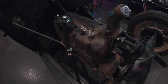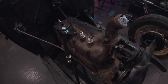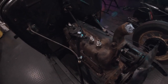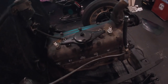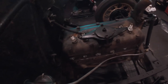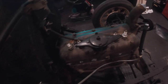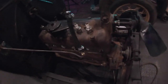What I like to do when painting a motor is use old spark plugs. This one actually had a new set in, so I took those out. I'll put the old crappy ones in while I'm painting and cleaning so I don't care what happens to them — if I get paint on them, hit them with a sander or wire wheel. Took the good ones out and put the old ones in.